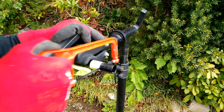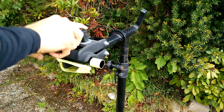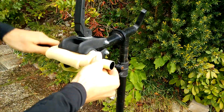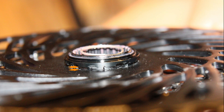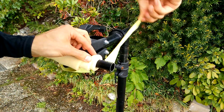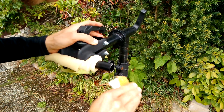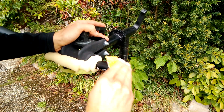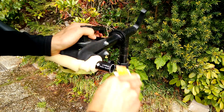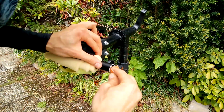There were a lot of parts and standards I had never worked with before. One such was SRAM components, and the cassette installation ended up being the first major challenge. The cassette did not seat properly on the hub when I thought I had torqued it down, but because the XD cassette type has quite high internal friction, all it took was more torque and the cassette seated properly. 40 Newton meters is a lot after all, and it was my exaggerated cautiousness that cost me the better part of two frustrated late-night hours not shown in the time-lapse footage.